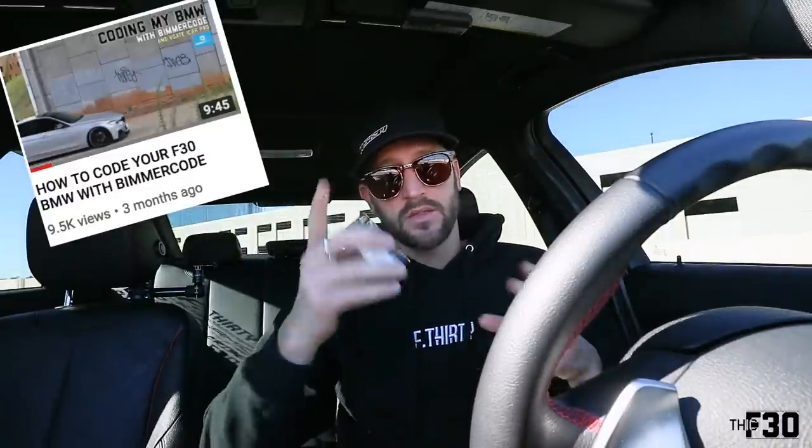All right, guys, so in order to code in enhanced Bluetooth on this F30 BMW, we're gonna use the app Bimmercode. You can download it from the App Store. We are also going to use the iCar Pro V-Gate 2. If you guys are unfamiliar with any of this stuff, please check this video, and that'll explain how to use Bimmercode to code your car. So we're gonna go ahead and plug this into our OBD2. Once you have that plugged in, go ahead and open up your Bimmercode app, and you'll hit connect. Once the app loads, it'll look like this.